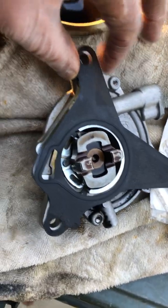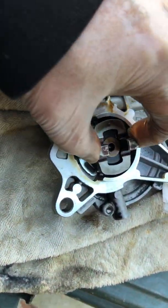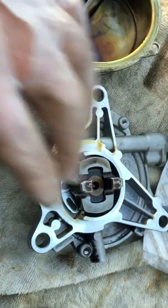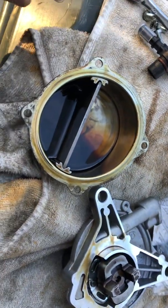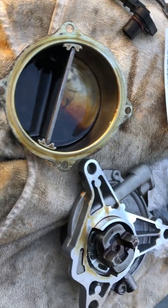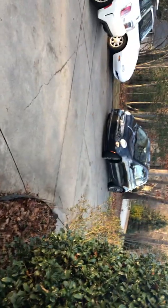It's a T45, three times 15 foot-pounds of torque to tighten it up. This is kind of normal — the way this thing tilts and rocks. Anyway, that's the inside of one of these vacuum pumps for anybody who wants to know. That's the end of my Fiat vacuum pump autopsy. It's definitely dead, and I've got a new one in there. As you can hear, the car is ticking like a clock and working perfectly fine.